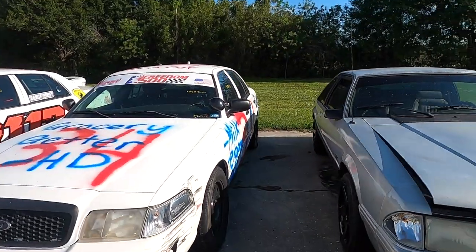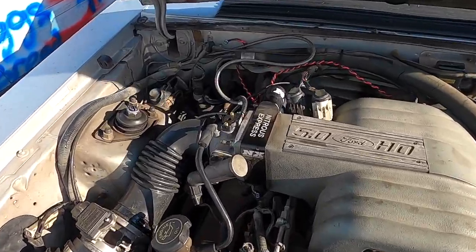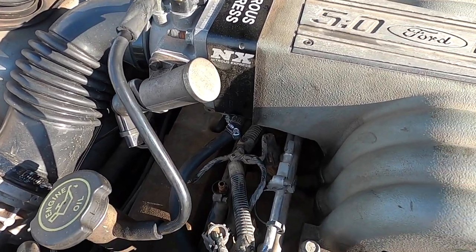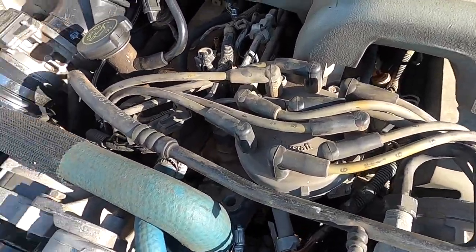This has been so much fun. This is the car. I got some different size wheels for it because Cletus has a deal with Nitto, get some tires for this thing. I'm going to show a coolant leak underneath the throttle body and the nitrous plate, so I got to pull that apart and put a new coolant line on. I also have a new distributor cap. The car's been idling really rough at idle, so I was taking a look at it. The distributor cap has a little bit of build up inside of it, so I'm going to change that out and the rotor and the coil and see where we get with that.